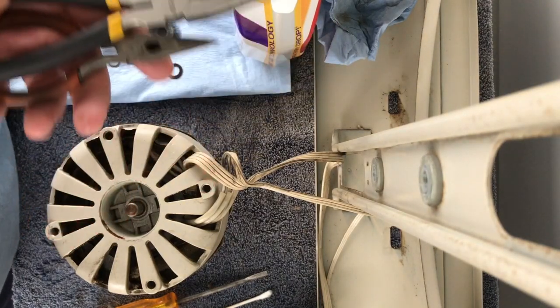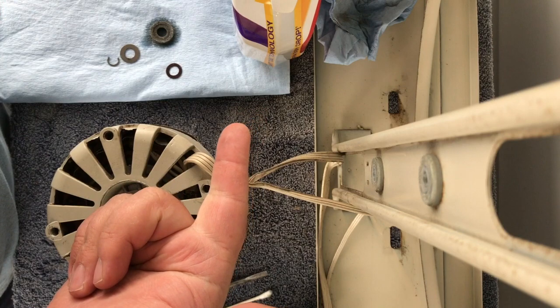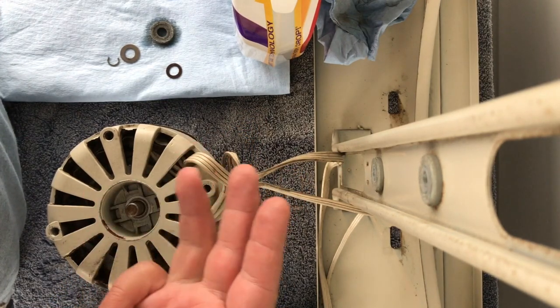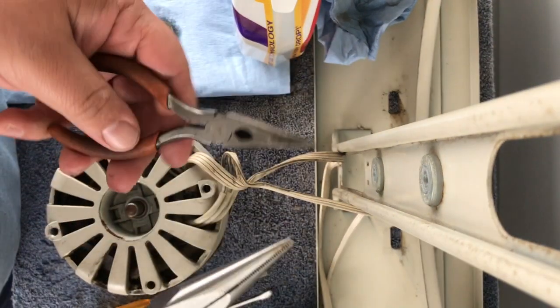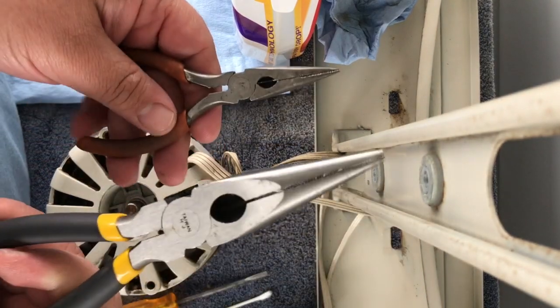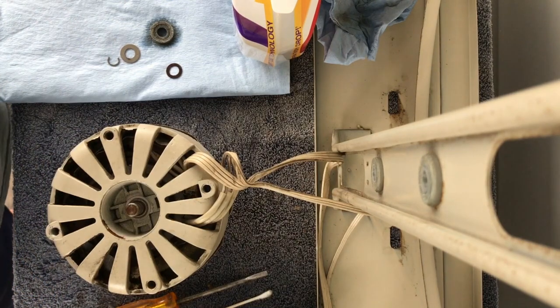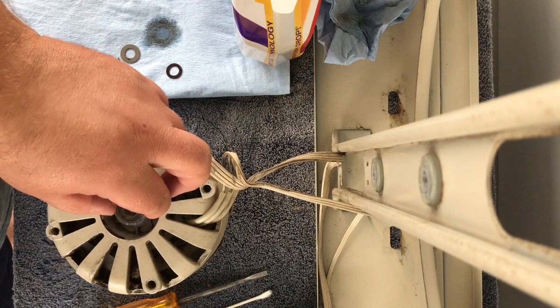All right, now we're ready to go in. It's going to be felt first, plastic brown one next, metal one with the tooth third, and then the C-clip. And the C-clip is difficult to get back on because it's kind of deep in there. So I remember last year needing those pliers and maybe, I don't know what I used. But we're going to start putting this back together.